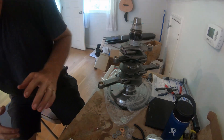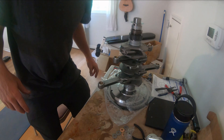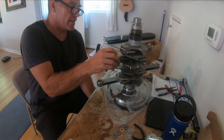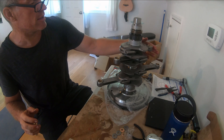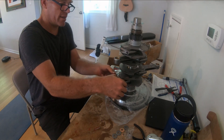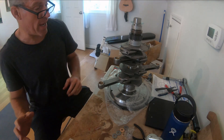I'm hoping the 84mm crank is okay. People say that between 82 and 84mm stroke you go from easy turnkey to a pain in the ass on the 84s and 86s, but I have no experience with it so I won't know until I get there. So far this is great. This is going to have the 94mm pistons so it should have some really good power.